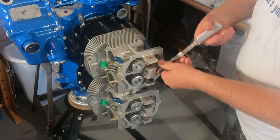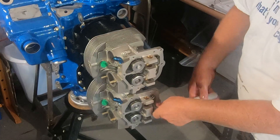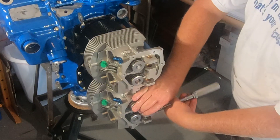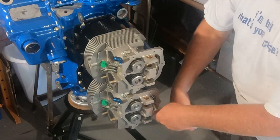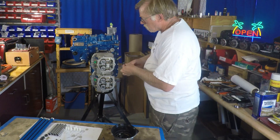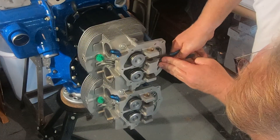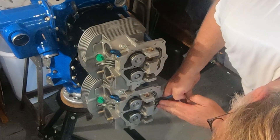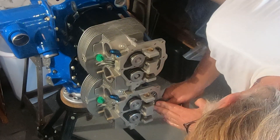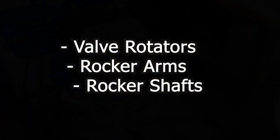Use a torque wrench at all times. Our torque wrenches go out every year for calibration — if you're overhauling an engine that you or someone else's life depends on, it's very important that you have calibrated tools. Close enough doesn't cut it on something of this nature. My personal preference is instead of hammering or chiseling the lock tab, I use a pair of channel-lock style pliers — it gives you nice leverage. The lock tabs are soft metal and that works much better than hammering.